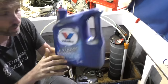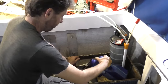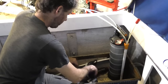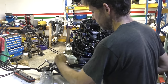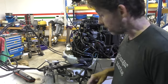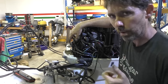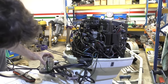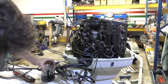What I'm using here is a Valvoline two-stroke, which I particularly like because it's the only brand available. Surprisingly, some of that even went into the reservoir. Now I'm going to pop the oil line off, just pop it into a jar, and then use the prime bulb to put some fresh oil through the line. In a previous video we cleaned out the VRO pump so it's clean, but it's also empty, so I presume I have to prime a bit of oil into that as well. I'd say that's pretty close to enough to guarantee we've got clean oil coming all the way through — I can't imagine the bulb and the length of hose holding any more than that.